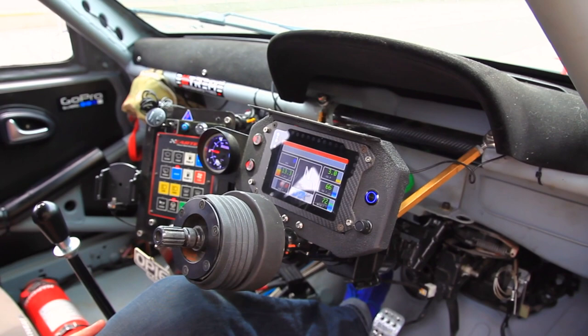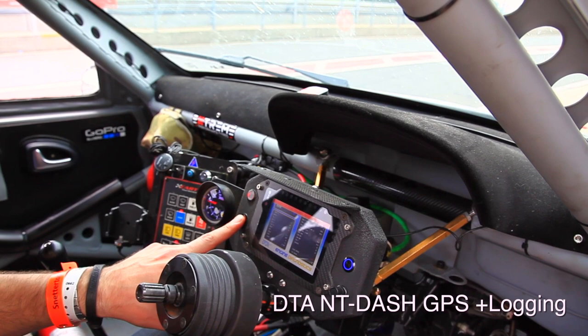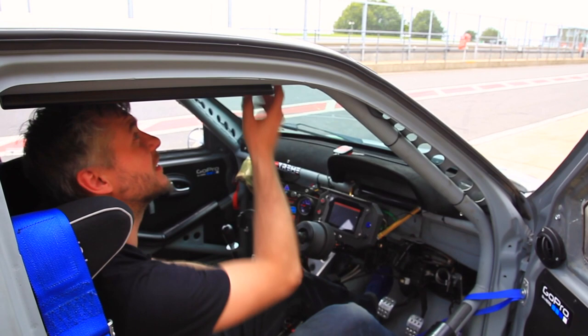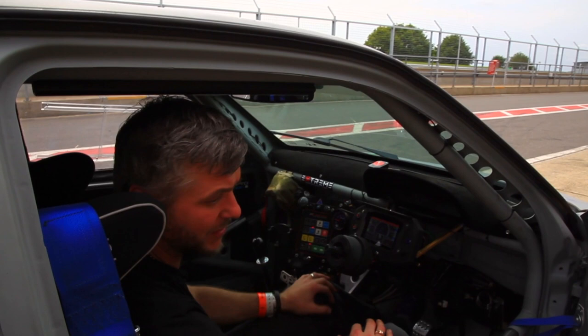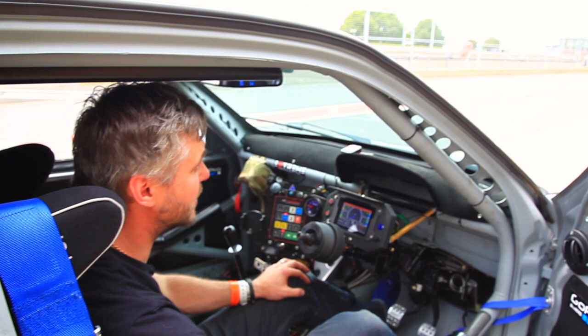The dash is DTA Fast — that's the NT series dash. It has lots of different features; everything is fully customizable. It has a bunch of diagnostics and different screens for different gauges. It also has GPS — that's how I'm getting my speed. That's basically the GPS unit antenna, so the car knows where it is all the time. You can have a map, lap timer, and everything. Essential information like oil temperature, water temperature, and fuel level is all there.